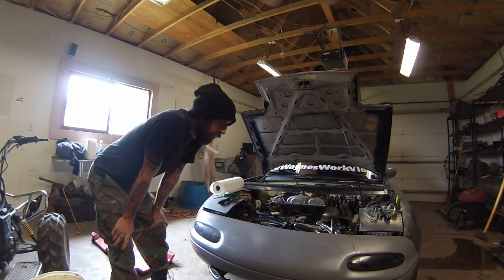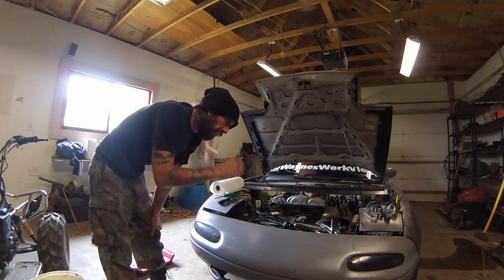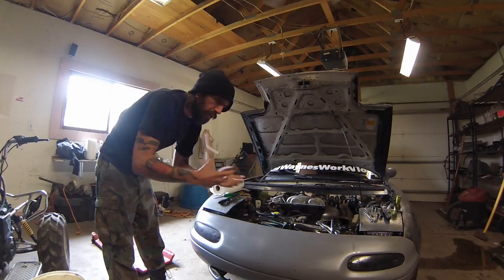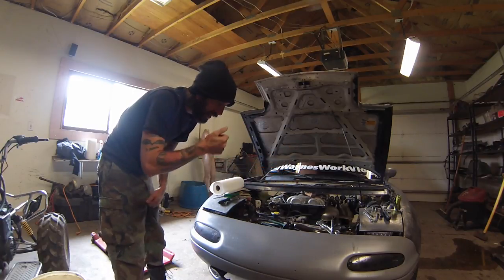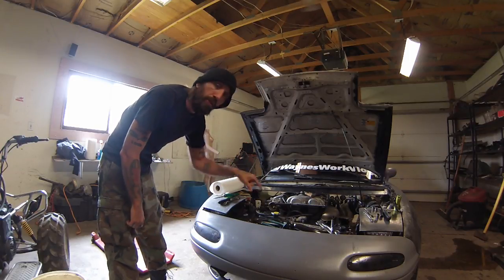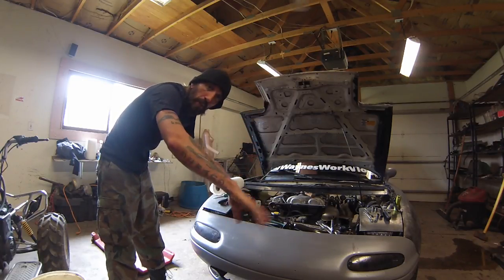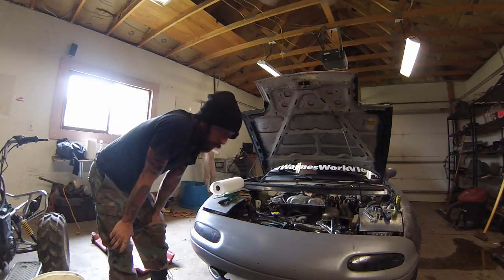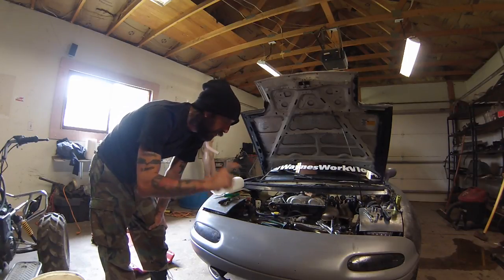We've done everything we need to do for the delete, now it's time for the de-power. There are a couple of ways to do this. Obviously you can take the rack off the car, but if you do it at the tie rod ends you're going to have to adjust your front end alignment. If you take the rack off at the tie rod outers then you're going to have a really hard time keeping the rack still while you disengage the tie rod inners. So it's easier to do the tie rod inners on the car. If you break the tie rod inners loose first, you can just drop them with the outers and you don't have to adjust your alignment when you're done. You just put the rack back in and put the inners back on. I need to get the car in the air so I can get to the power steering rack, so I'm going to get the car up on jacks and spray a lot of degreaser to get as much crap out of there as I can.